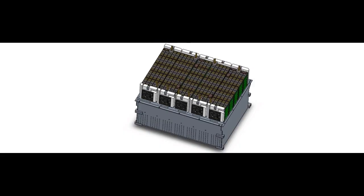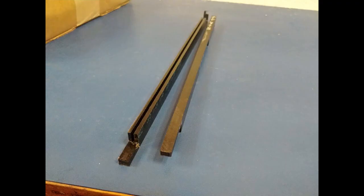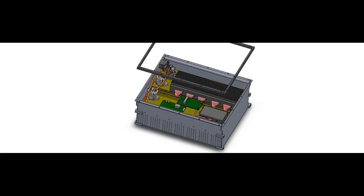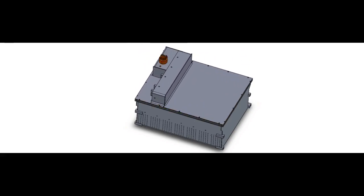Here I'll show you the general assembly of our accumulator. First, the segments are installed, and then plastic insulating barriers are placed on top of the inner walls of the accumulator. They wrap completely around the wall and help constrain the batteries vertically. Then Kevlar panels are placed on top of these walls and taped in place. Following this, a Kevlar panel with the rest of the accumulator components can be installed on top. A spacer goes on top of the box, then the main lid gets installed, and then the service lid gets installed.